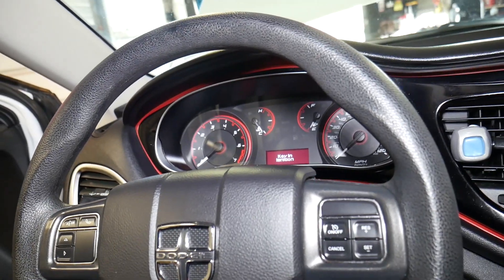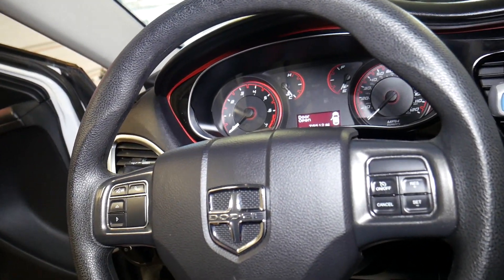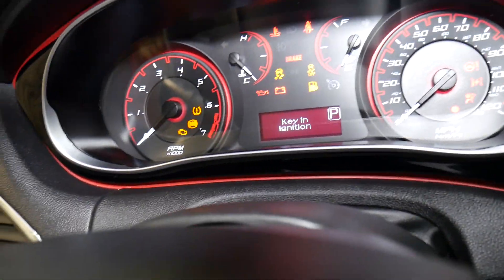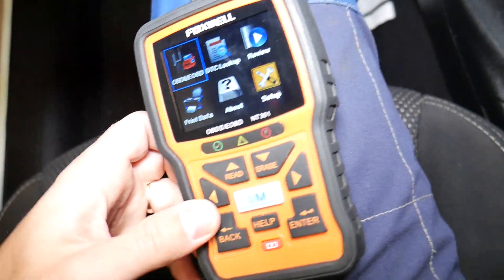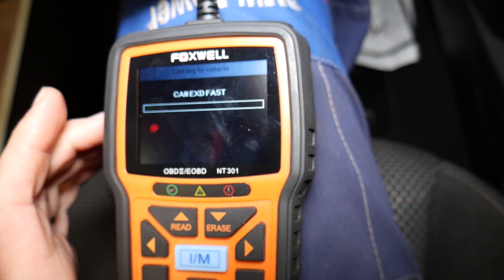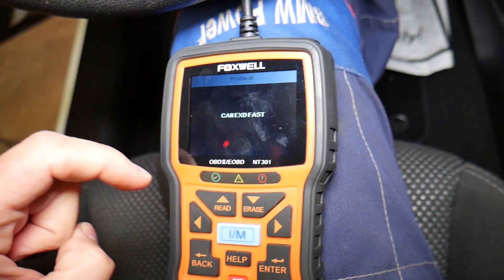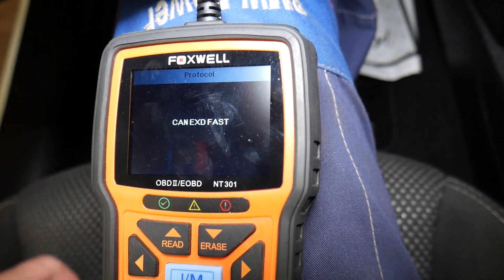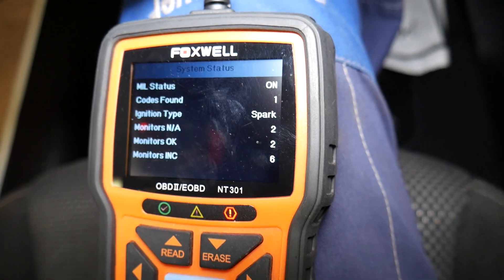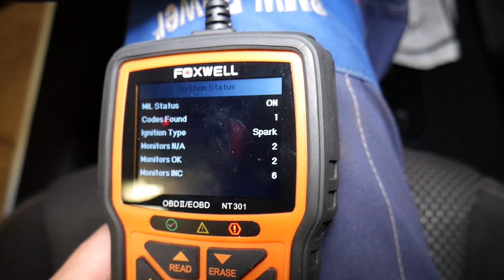You can see the car is misfiring — it sounds terrible, it's lacking power, it's not moving as it should. We'll turn the ignition on without starting the engine and connect the scanner to read the codes. It's a pretty cheap but very good scanner that can show live data — you can find the link in the description below. It's loading now.